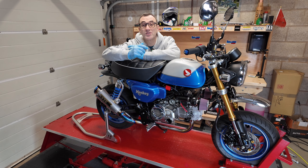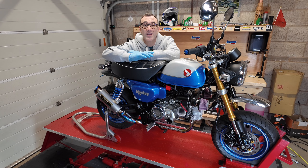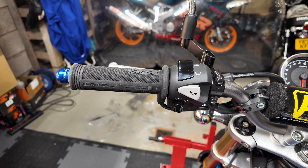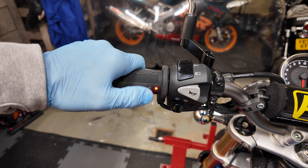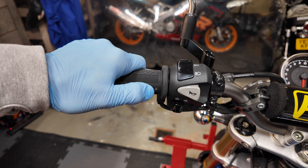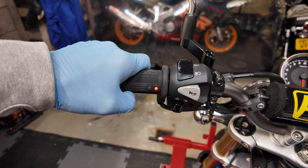There's a battery saver function — the grips auto switch off if the voltage starts to drop. There are three settings for this: one for a standard lead acid AGM type battery, one for a lithium battery, and one switched off altogether, though the instructions warn that if you switch it off the grips will drain your battery. To change between these settings, switch them on, then hold the button for about seven seconds — this turns the grips off and flashes the LED: one flash for lead acid, three flashes for off, and five flashes for lithium battery. Just cycle through until you get the correct setting.